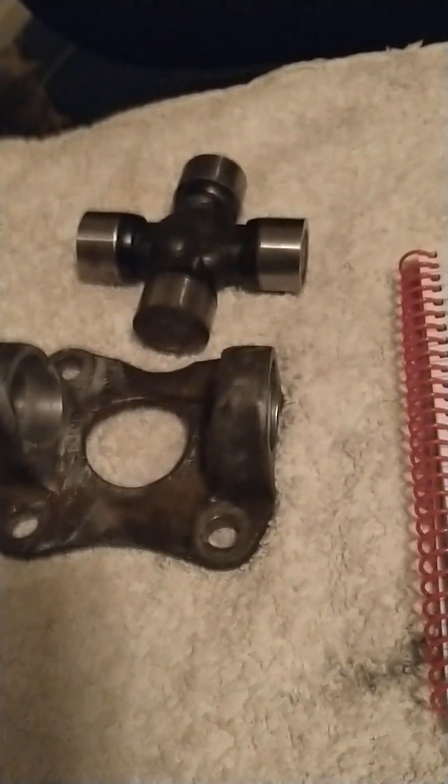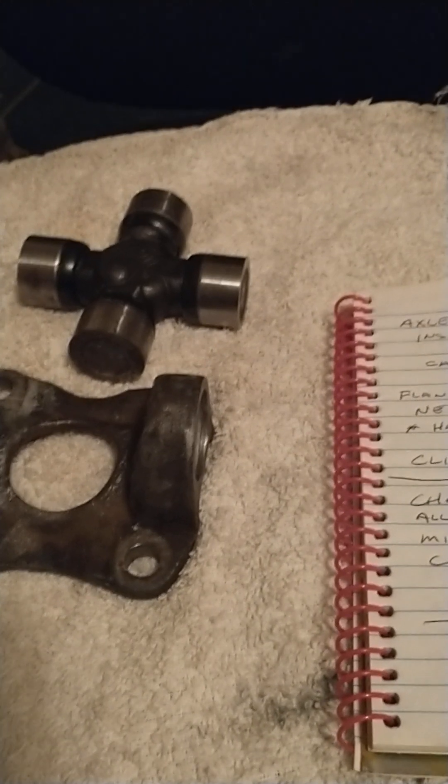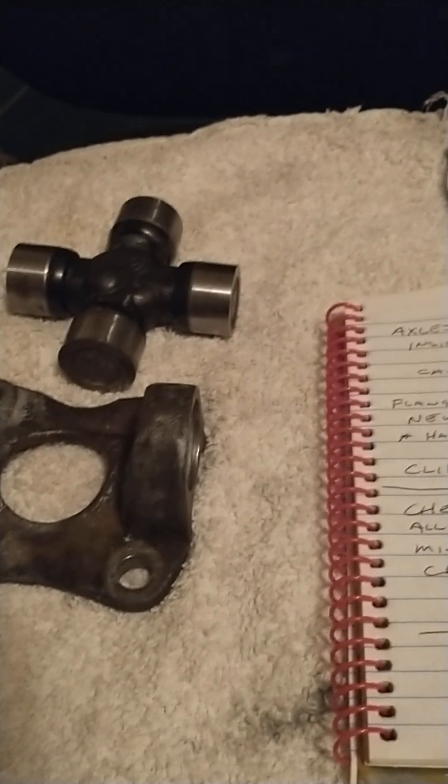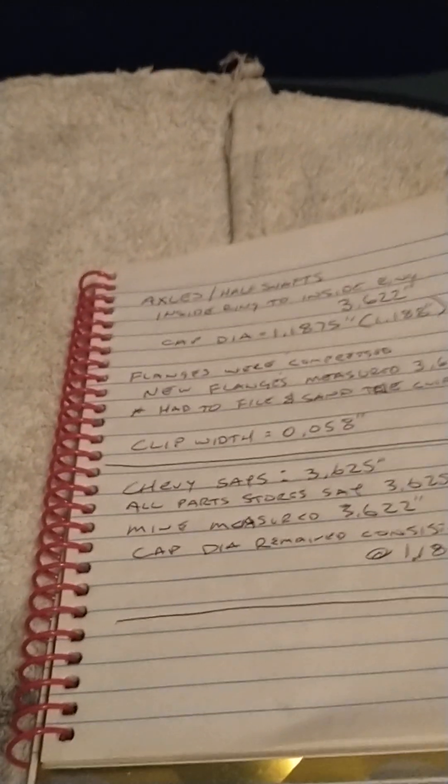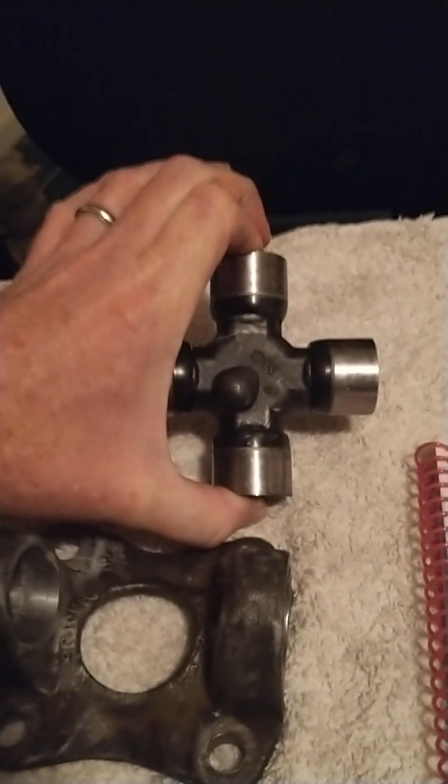I'm not sure whether my old 75 Corvette just measures 3.622 on the half shafts, or whether they've been compressed exactly three thousandths from 3.625. The new flanges I ordered from ZIP — link below — also came in at 3.622 inches. So from inside clip ring to inside clip ring, both my half shafts and the new flanges measure 3.622 inches. Therefore, when you go to the parts store and see u-joints measuring 3.625 inches, you're going to be three thousandths too fat on both axes before you even start.